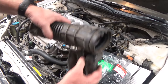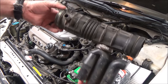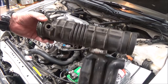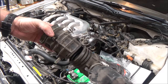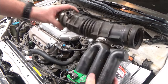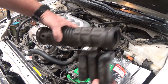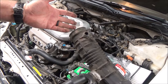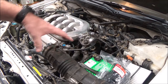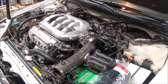You can see this is the tube that comes off this car — sits in right like that. At a quick glance everything looks fine, but this thing's hard as a rock and as you can see it's split right down the middle. When it's sitting down in there like that you probably won't even be able to notice it, and that's definitely gonna suck air in. It's after the air filter now, but it is before the MAP sensor.